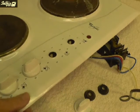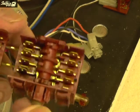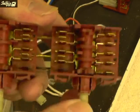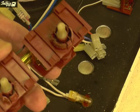There are no internal connections on these regulator switches, so unless there is a visible fault such as a burnt out connection or a broken or defective part of the switch, the regulator should be okay. There's nothing wrong with this regulator — I'm just removing and refitting the same one to show the job is not as complex as it first looks.